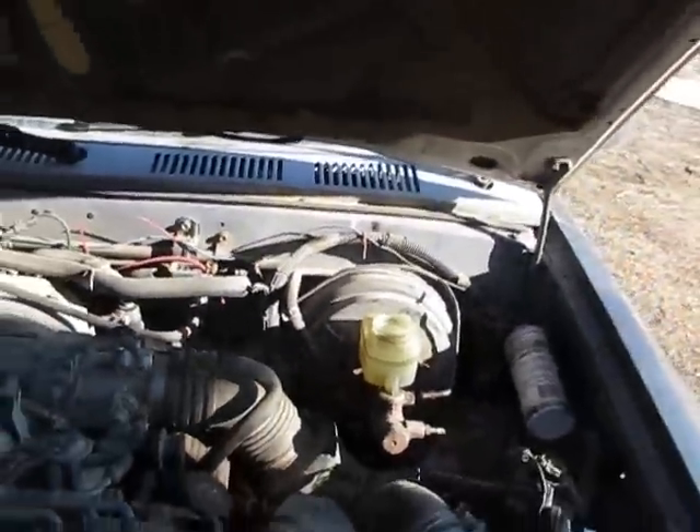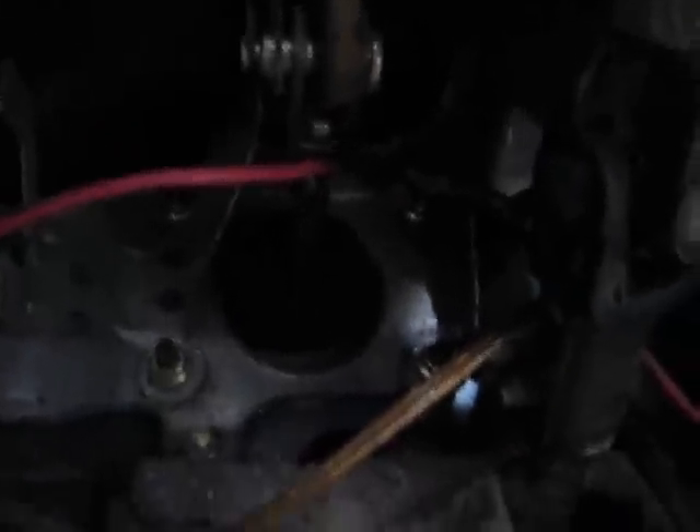Now the rest of the work is inside. Those four bolts right there are really accessible — those are the four ones we need. I'm going to remove this spring and that clip and then wiggle the pin out. When you're taking the bolts off I strongly recommend taking this one off last. Start with the hardest to get to one and work your way from hardest to easiest, because if you leave the hardest one till last the brake booster will start backing off and it just gets harder.